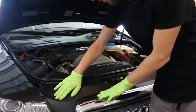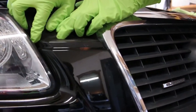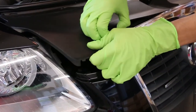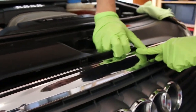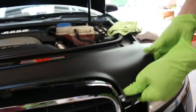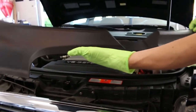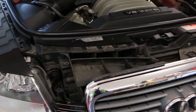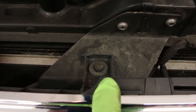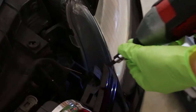One of the first steps is to remove this top plastic cover right here. Down here you'll actually see these little tabs — pull back and out. You can pull them with your fingers like so; the little tab slides out. If you need to, you can bend it to make sure you clear this spot, but other than that there's no screws holding this in. Now with this top part exposed, you're going to want to remove a torx — believe it's a T30 right here. Little bro's gonna get in on some action — go ahead and remove that T30.